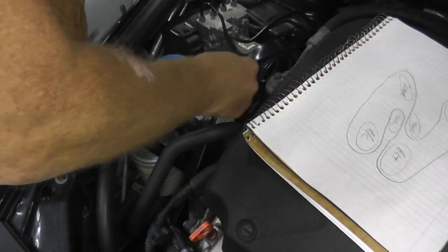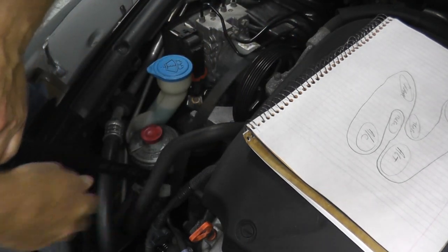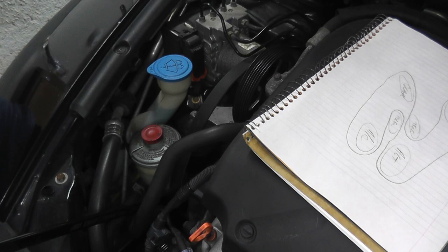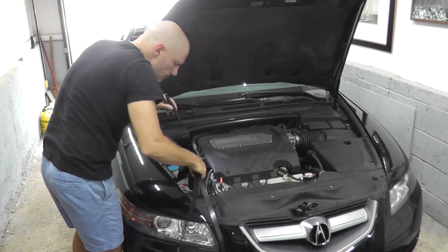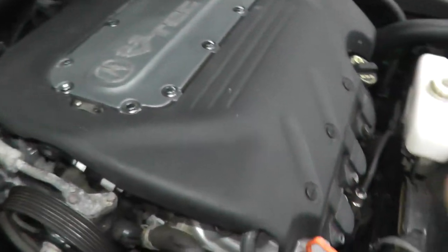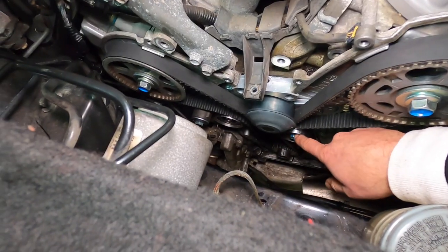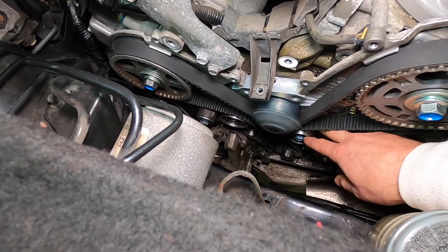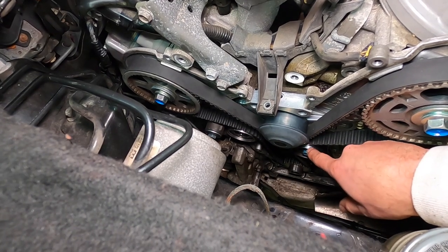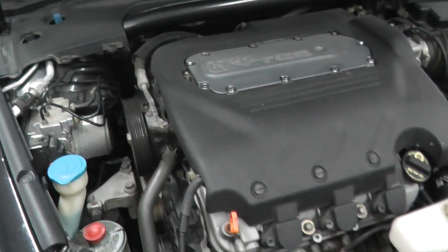The reason why we can start the vehicle once we remove the drive belt is to verify that we have no issues within the timing belt. If there's an issue within the timing belt assembly — bearings, tensioners, and so forth — maybe one of those is starting to go. If you remove the belt and still hear that noise, then you've isolated where the problem is.